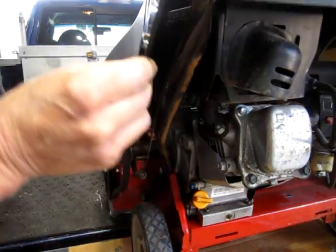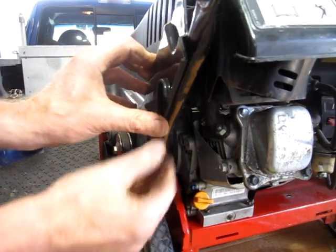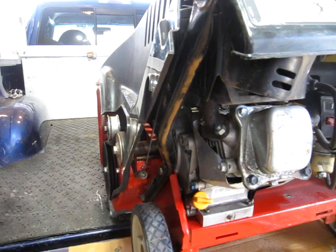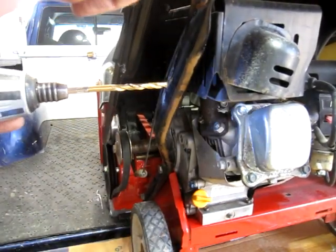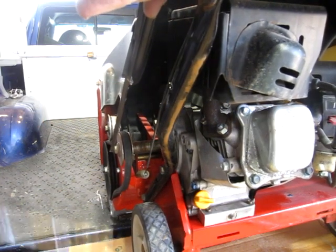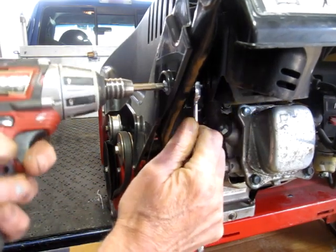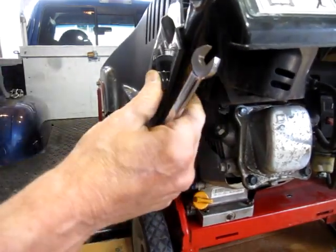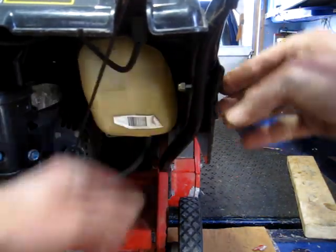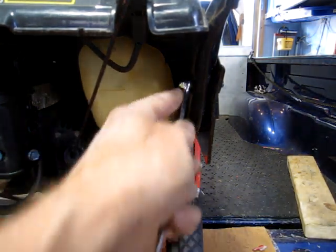I also noticed while moving it that the bolts are missing from this shroud or cover on both sides. So I found some 1/4 inch that I'm gonna make work. Putting lock nuts on these as well, Nylocks, just so they don't back out.